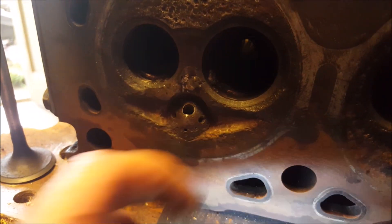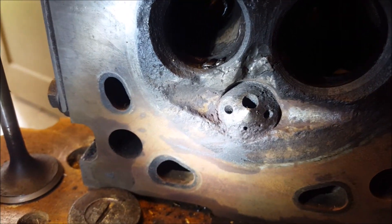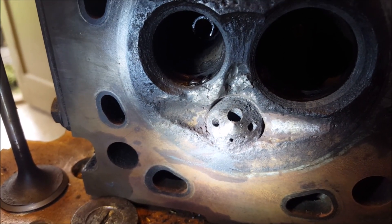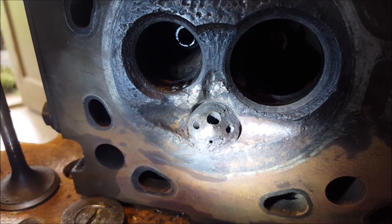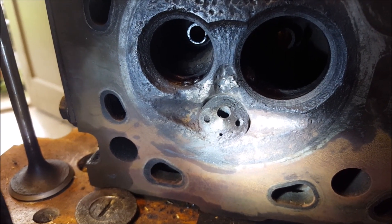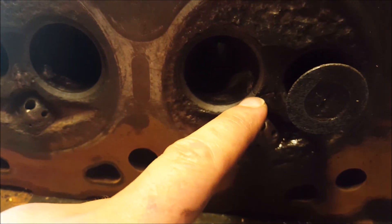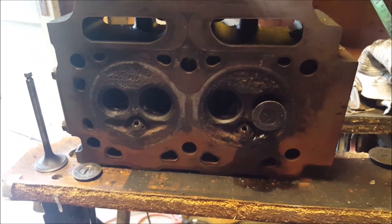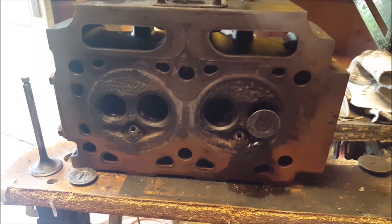These two are going to need more work — I did them with coarse and fine, but after examining them I'll have to go back with the coarse again. The other problem is the cracks right there: see where the block actually cracked from here to here? That's why I welded it, but the crack went straight across the sealing surface between the valve seat and the valve. So I will be losing compression there every time the piston comes up and both valves are closed, trying to squish the air — some of it is going to leak out of those cracks. That's another reason I want to shave the head a little more, to steal back some of that compression loss.